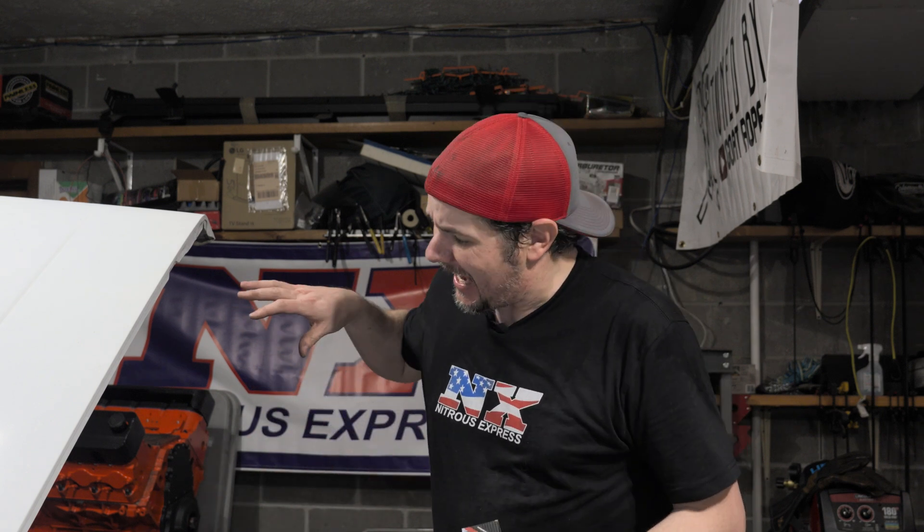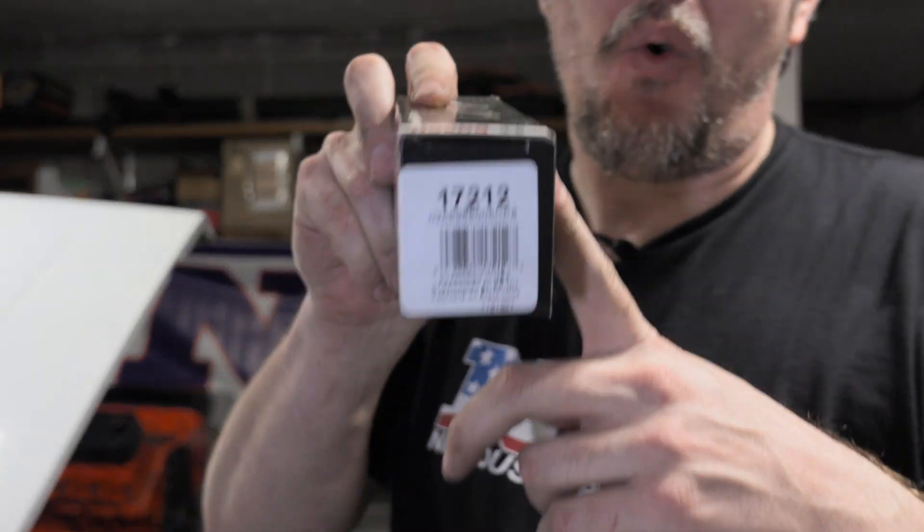So not the cheapest way, but possibly the quickest way to get yourself out of a jam, especially if you're dealing with a system that is very reliant upon closed loop operation. Don't get caught up in the fact that everybody tries to tell you that you have to use their sensor. As long as the connector is the same, you should be good to go. There are a couple of outliers — you've got to be careful with the Holley stuff, they're kind of a pain as usual. But you can rewire those connectors to work with the standard 4.9 or 4.2.